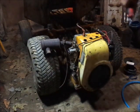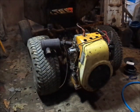It's 8 o'clock right now, so I think I'm going to call it a night out here. And that's a good place to stop. I'll come out in the morning and see if the fuel line's wet anywhere. I had one leak back here at the end of the frame where it goes from rubber to steel. I had to slide the rubber line up a little further and clamp it again. And everything seemed good there.